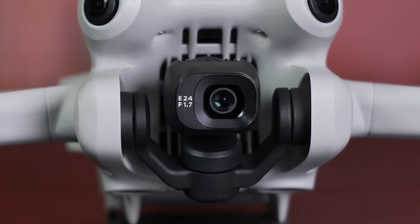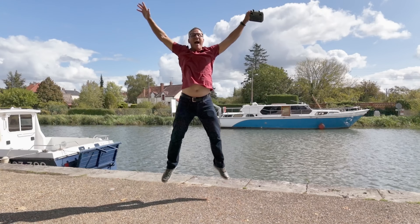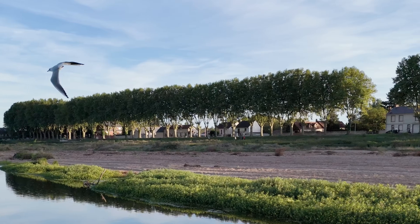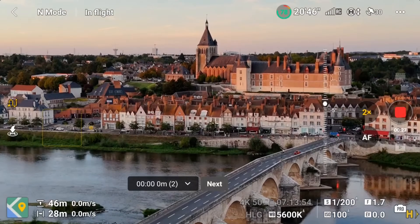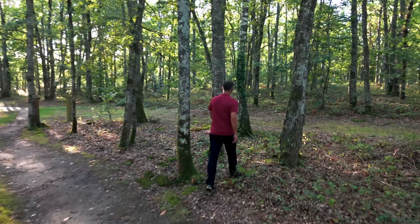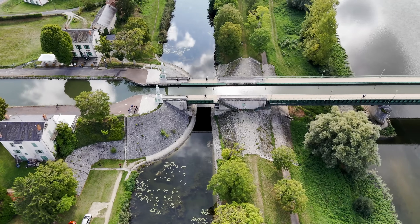The Mini 4 Pro's camera has the same big 1/1.3-inch dual ISO sensor as its predecessor, using an identical 24mm equivalent lens with a fixed f/1.7 aperture. The difference is that it now supports 4K slow-mo at up to 100 frames per second, or 1080p at 200 frames per second — both stored as 30fps slow-mo files, a nice feature for wildlife, crashing waves, and more. That's on top of 4K at up to 60fps and 1080p at 120fps. It has a 2x digital zoom for 4K and 4x for 1080p with a slight loss in sharpness. It supports DJI's D-Log M, which boosts dynamic range and gives you more flexibility in post. DJI also has a LUT that makes it easy to convert it to regular video. You can also shoot in HLG mode, which again boosts dynamic range but needs no post-processing. Both support 10-bit 4:2:0 capture for improved fidelity and reduced banding.